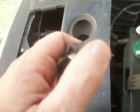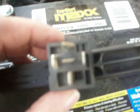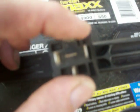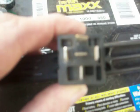Wiring it isn't too complicated. But because we have computers and what not, we don't want to fry our computers accidentally, so we are using a relay switch — which is connected directly to the battery. Relays generally look like this. This is a 30-amp relay. You have one wire coming off your ignition and one to ground, off of these two sides. It doesn't matter which one you use, as long as you use these two sides — one off the ignition and one ground. The other two: one on the battery and the other one goes to the bottle. It doesn't matter which one you use, as long as you are using these two. The center one — ignore it, leave it alone, don't need it.